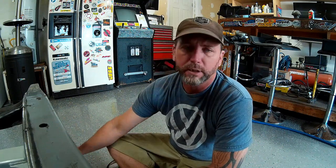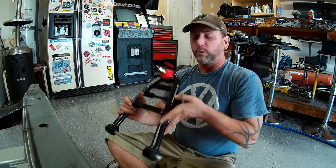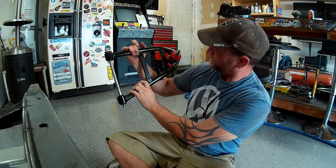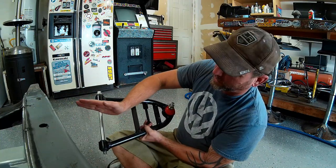I've got you here on the magnet mount so we can take a look at how these arms are going to fit together. Before I put the top hats or the coil spring mount onto the frame, I want to make sure that my lower control arms are straight, ball joints are in line with the center line of this crossmember as they should be, and try to get an idea of how the coil and the shock angle are going to line up into this coil bucket so that we're not binding the coil or the coil is not rubbing the shock. These are our lower control arms. As you can see, the ball joint is offset from the center line of the crossmember.